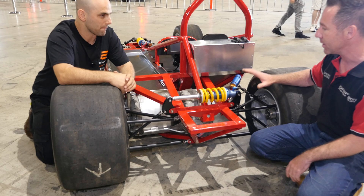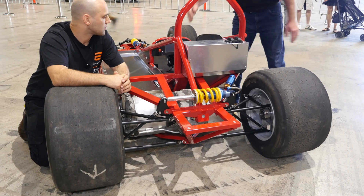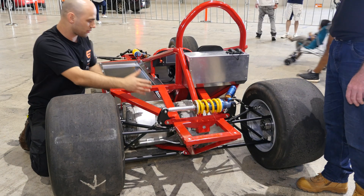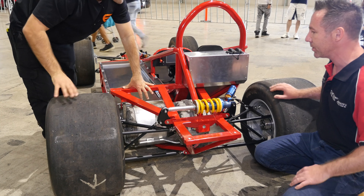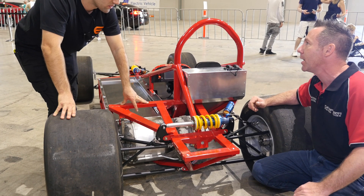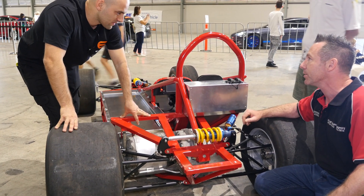When you're designing a car, if you want good handling characteristics, you want all of the weight in between the wheels and as close to the center line as possible. So you get the driver weight, battery weight, motor weight - you just try to balance around it. The reality is we should have a fairly decent side-to-side split, almost perfect. And we'll have about a 60-40 rear to front split. And then under braking you end up with a 50-50 through the corner.